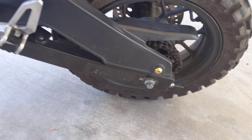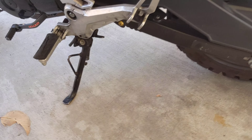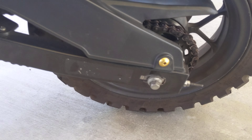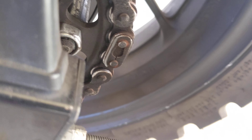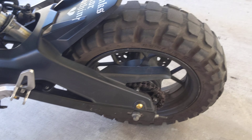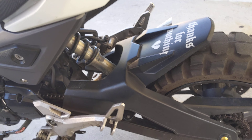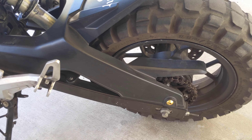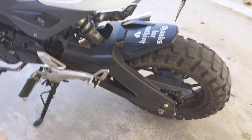Pretty simple. I'm going to try to do it without needing to take off this cover or the front cover — it's not a big deal. Otherwise it would just be that allen key and then this allen key. You should be able to just take off the master link here. Chain comes apart, you attach the new chain to the old one, rotate the sprocket, feed the new chain in. Put the new master link on, grease it, and you'll be good.